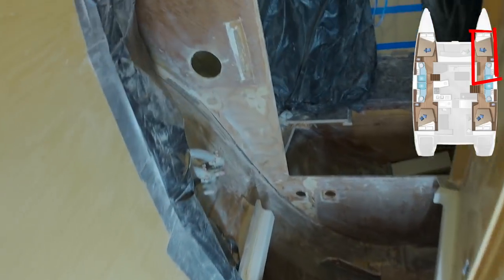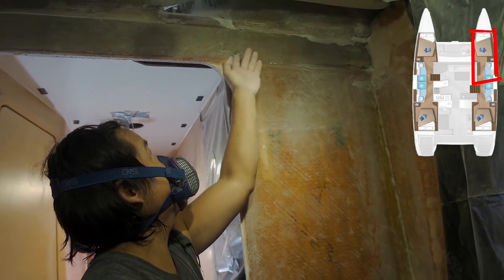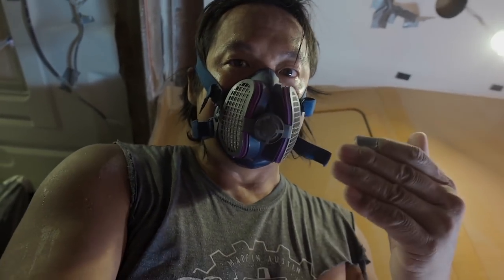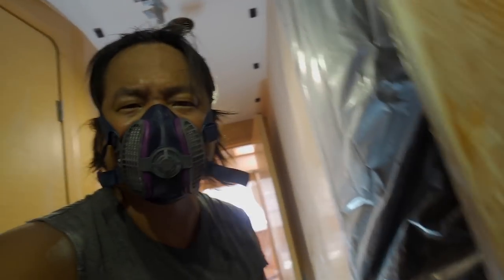We're gonna fix these bulkheads. A nice taper right here where the crack was, and it tapers out slowly. Plywood on both sides. It's gonna be super duper strong. You can see how this original middle bulkhead is not actually even touching the hull. Look, there's a gap behind it. If we look from the other side, you can probably see light coming through. See? There should be some cabosil or some kind of mud or glue or something in there, right?